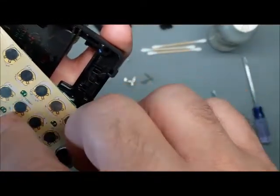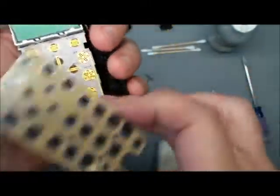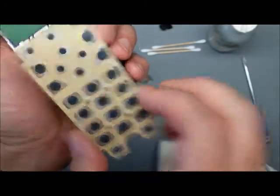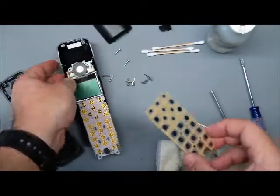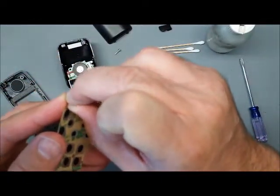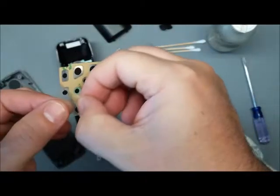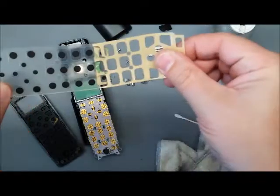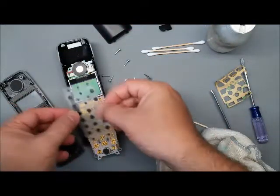Now these phones, they don't have LEDs for lighting up the buttons, but there is a spot for them, so I'm assuming there's another model of phone besides the 300 and 600 that this keypad will fit on. But anyway, to put this on, you just peel off the brown paper liner. I like to grab at a corner and just slowly peel it off. If you rip too fast, it'll probably tear, and then you'll get little pieces. So go slow and it'll come right off.